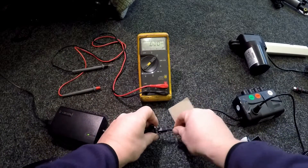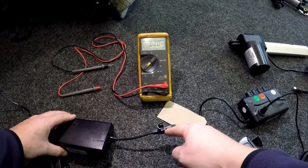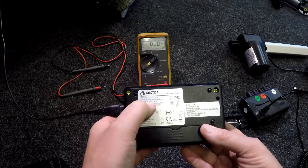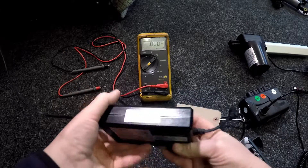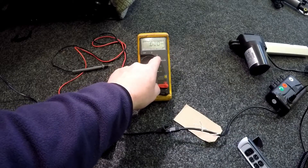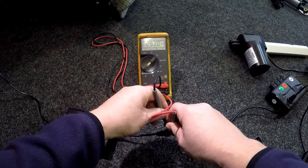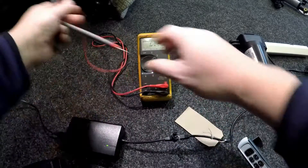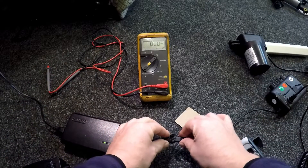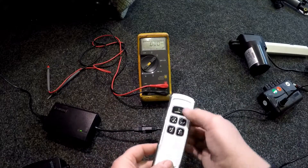But we can also check voltage here. Pull the terminal out slightly to get a good contact and check the voltage. Before sticking the voltmeter in, check what the output is — at the back of the transformer it says output: 29 volts, 2.5 amps, so it's 29-volt DC direct current. Set your voltmeter to DC, not AC — AC is what you have in the house. Put the terminals one on each side and we read 29.3 volts, so we know for a fact there's power coming out of the transformer.